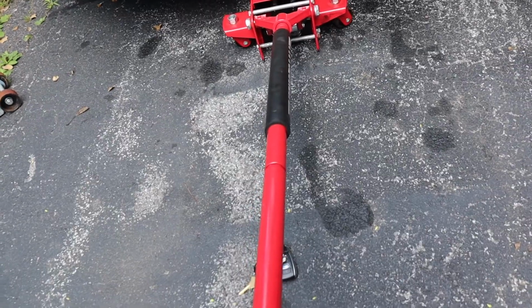So I did just adjust them one time around, and I'm not really sure how much one time around really is. I'm trying to do this in my head because that might be like a ¼ inch. So I might do it like 1.5 times because, you know, the front gap was pretty massive. So we'll do 1.5 times, and hopefully it's not too low because it's hot. I don't feel like doing this over and over again. Before just adjusting both sides, we're gonna do a bit of a test fit here just to see if 1.5 times will do good.